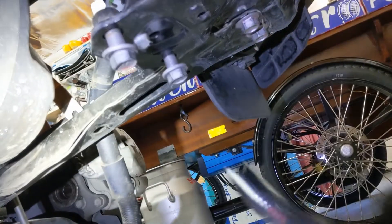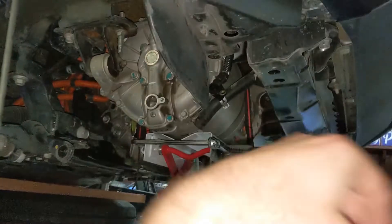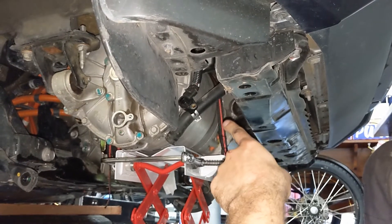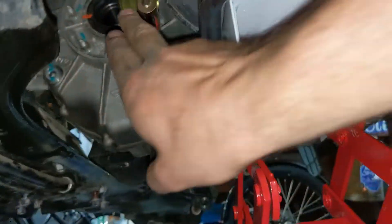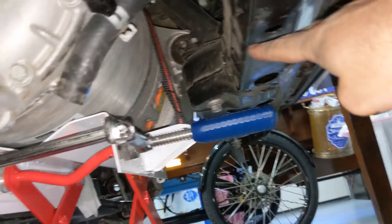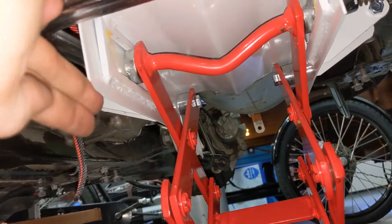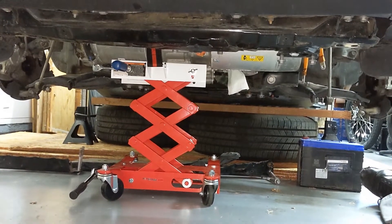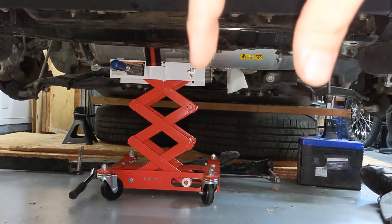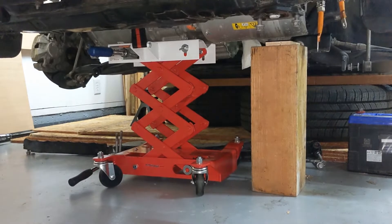Use an impact unit to make it quick. We have removed the beams. We have positioned the transmission lift below the motor, jacked it up, and there is a strap for safety going over the motor. Be careful not to pinch any electrical wires between the motor and the strap. The ratchet had to be on this side because on the other side it would interfere with the beam. I also put a wood clamp around this Harbor Freight transmission lift because if you tighten the ratchet it will pull the flange out and the little wheel will flop out. The transmission lift is off-center because the electric motor is the heaviest part — the inverter is just printed circuit boards and aluminum cast cooling parts — so I put a block there in case the motor wants to tilt while I loosen the final bolts.